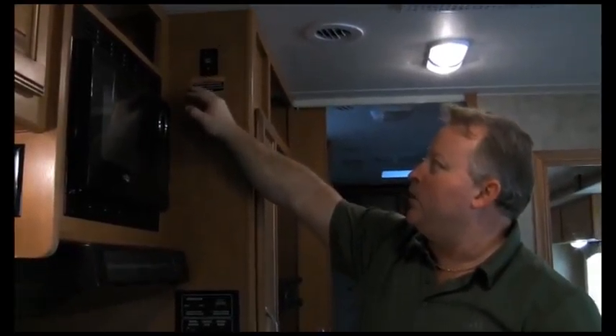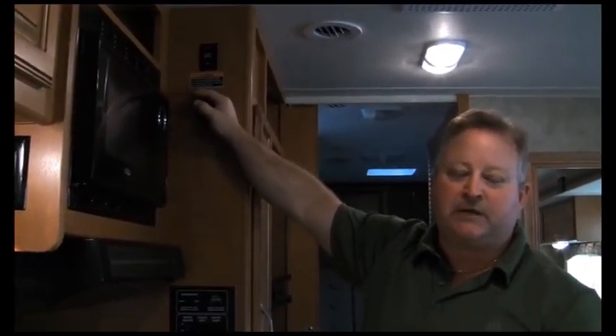Your slide-out switches are right here — they vary by model and are sometimes put in crazy places like inside a cupboard, but they'll usually be labeled slide-out switch. Some coaches require the engine to be turned off; some require the engine to be running. With Winnebagos, the engine needs to be running. All motorhomes require that the parking brake is set. Some Class A's require the seat all the way forward — they'll be labeled if that's the case.